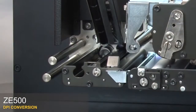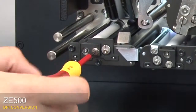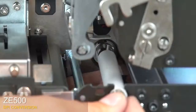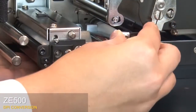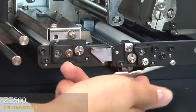Reinstall all three rollers. Position the pinch roller and press until you hear it click. Replace the cam plate and tighten the screw. Close the pinch roller assembly. Position the peel roller and press until you hear it click. Insert the tab into the mainframe slot. Replace the cam plate on the support pins. Tighten the center screw. Close the bracket.